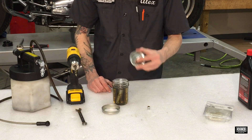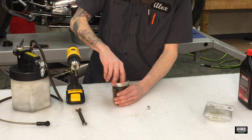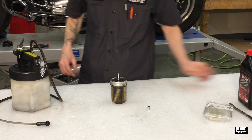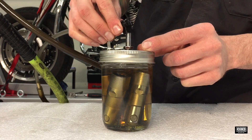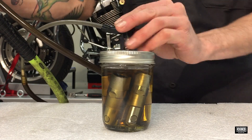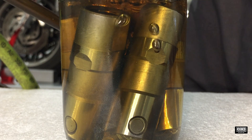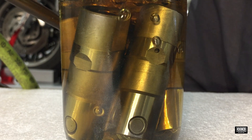I've also taken out the valve core to make this work. Go ahead and reinstall it, and now I'll get the MightyVac hooked up to air. Just hook it up and turn it on. You can see it sucking out all the air that's in the lifters, and in turn just sucking in oil and priming it all. Super slick putting those lifters in.